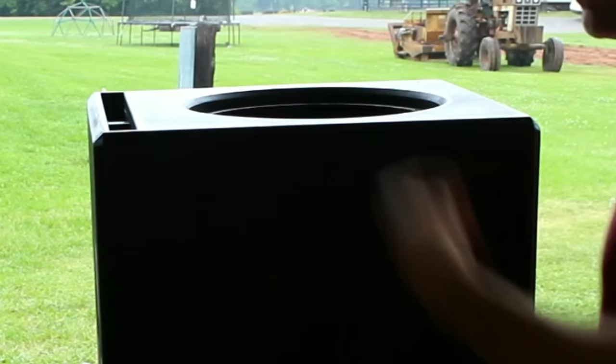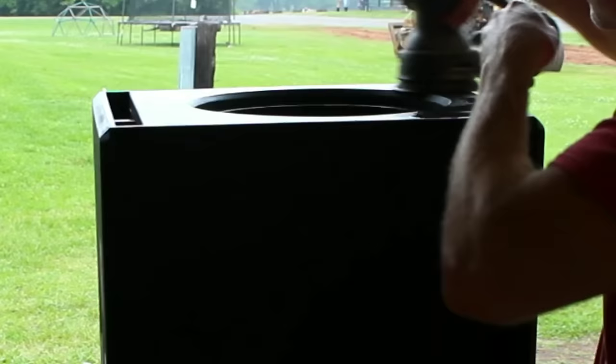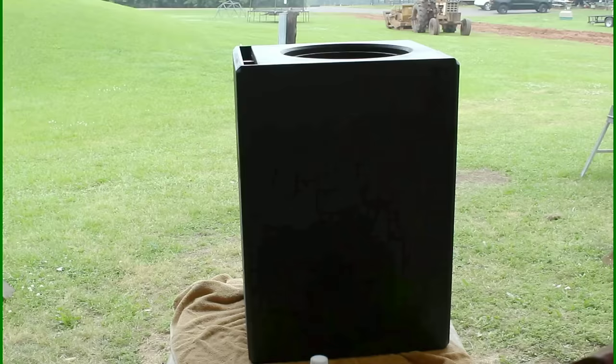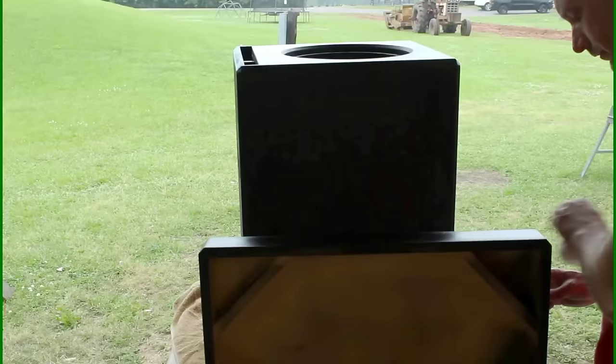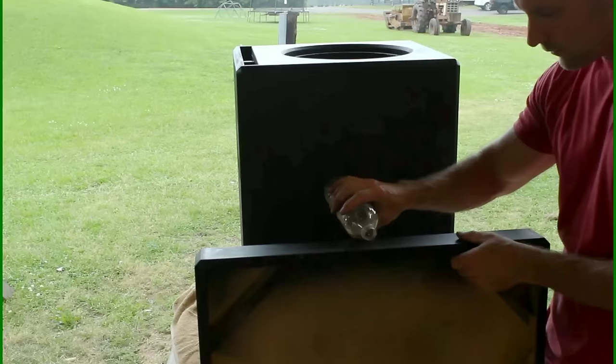Now we have to be very, very careful of the edges. The flat spots are kind of hard to screw up, because they're flat and you're evenly distributing your sanding disc. But if you hit an edge where all of a sudden you're putting a lot of PSI on a small area, it'll burn through so fast. Even in later steps, when we're messing with the rubbing compound, trying to get that high shine and bringing that glass out, you still have to be careful of the edges.